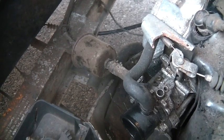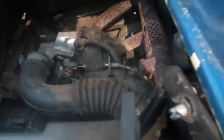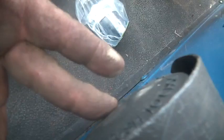I was running it up and down the driveway and it just seemed to be running rich. The airbox was in place and the hosing was all hooked up. I got it jacked up, opened the cover, and started it — and when I opened the cover it ran better. I took a look at the air filter and it doesn't look too bad. So I took the box off and — check it out — I've got bees building nests or caterpillars or whatever the hell it is right in the air intake. You push that button into the choke and it kind of seals it off, but those bees are sealing it off — you can see all the little catacombs.